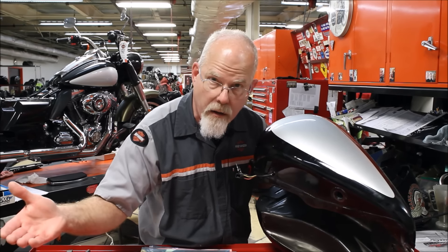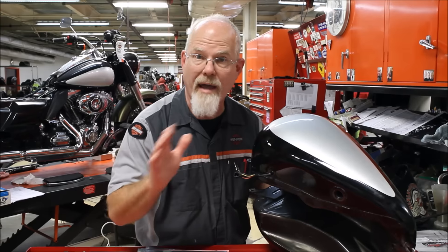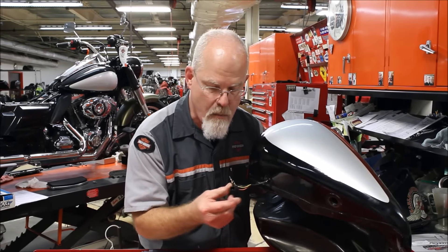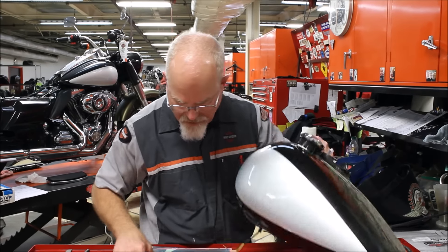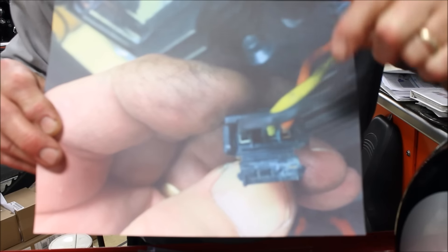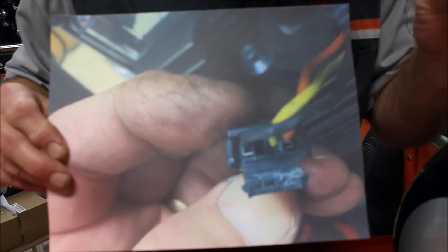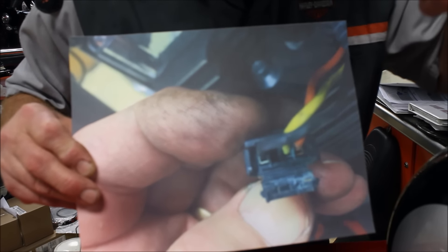You can match it with the other wire connection on the bike, but I like to mark it so I don't have to think twice — I can just put them back in. In disassembling this, Harley-Davidson has made one with a back that has a flip on it. There's a piece that flips up, and all you have to do is take a screwdriver on either end and flip it down. That's the first procedure in getting these out — you have to get this thing out of the way, otherwise they're not going to back off.